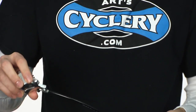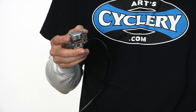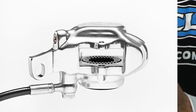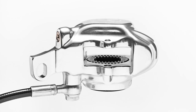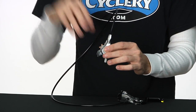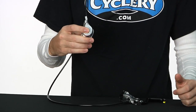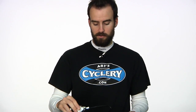Another really cool feature along the same lines of heat dissipation: you can see that the pistons are finned. What that allows is air to move behind the brake pads. Couple that with the top-loading design, and you have air able to move in front of the brake, move behind the pistons thanks to the fin design, and then move right out the back — it just cools off the brakes a lot, which is how they keep the brakes from fading even with this level of power.